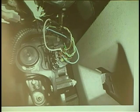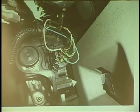So could you tell me by looking at this which ones are the 5-volt reference? You see the 2 twisted sisters? Which ones would be the 5-volt reference? Maybe these 2? Why is the wire twisted? Interference. So who do you want to protect? The signal. So what do you use to protect them? Ground. So they took the reference ground and wrapped it around the TPS line. I know these 2 wires are 5 volts.